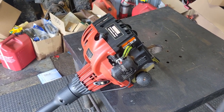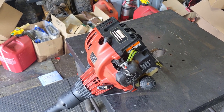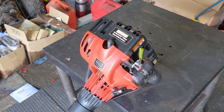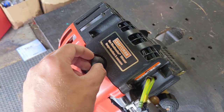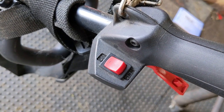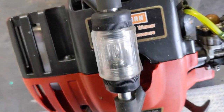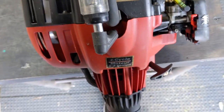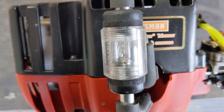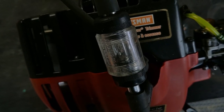For the purpose of this video, I'm going to redo everything I've already done. The first thing you want to do before putting any time or money into a machine is come up to the spark plug cap, take that off, and test for spark. Make sure the kill switch is in the on position. I have my inline spark tester plugged in — it's a light-up version with a little bulb. When I pull the pull-start cord, this light should light up if the coil is producing spark. And you can see we have all kinds of spark.